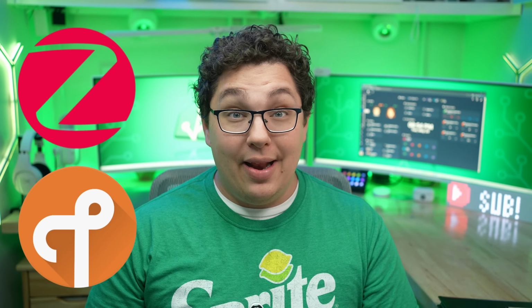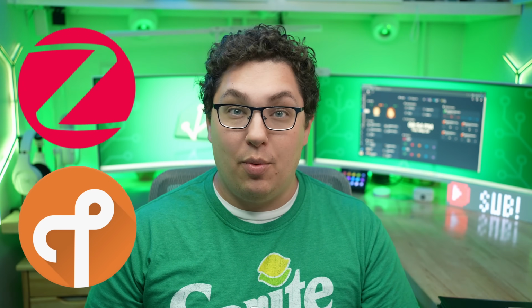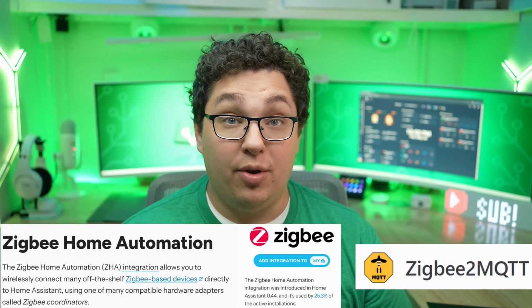One other thing is that while most of these devices use Wi-Fi, some use Zigbee or Thread, which are just some other wireless protocols. These protocols require a special hub or radio to get them working with your smart home platform, and while some smart home platforms have those radios built in, not all of them do. For this reason, if you're not using Home Assistant, you may want to stay away from those types. For any devices using Zigbee, I will be using the ZHA integration in Home Assistant, and so these devices may appear a little bit differently in the Zigbee to MQTT integration.